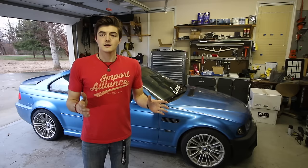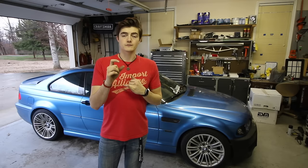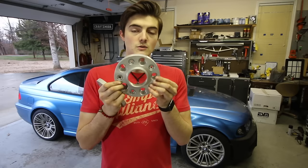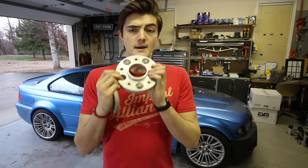One of the things I'm doing in this video is starting off with test fitting the wheels. The way I'm going to get the proper offset is to keep everything even. I have two different offset wheels — they're the same size, 18 by 11s. The front is a 15 offset and the rear is a 25 offset. So I've got a 15 millimeter spacer in the front and a 25 millimeter spacer in the rear. The front spacers aren't too big — I've run 15 millimeter spacers on the car before. The 25 millimeter spacer is one you actually have to bolt to your hub, and then from there you bolt your wheel to it. In my case I have wheel studs, so I'll put wheel studs in and then mount my wheel to the spacer. That should give me an even 18 by 11 setup all the way around the car.